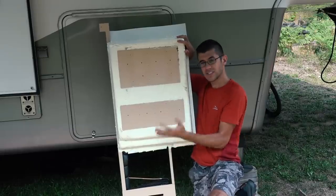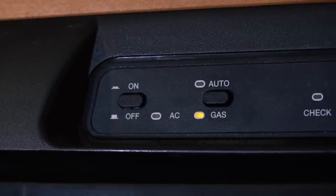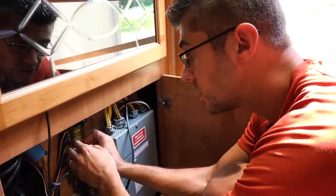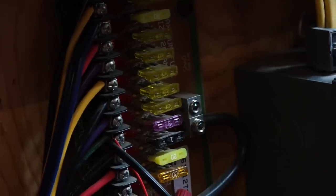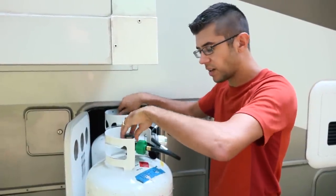For this project we'll be removing the refrigerator and laying it down on its face to access the back side. We removed everything from the refrigerator and shut it off to thaw. Luckily we can use someone else's refrigerator for a couple of days. Before pulling it out, we shut off power by pulling the 12-volt electric fuse for the fridge circuit so we don't accidentally short anything, and we shut off the propane to the entire RV.